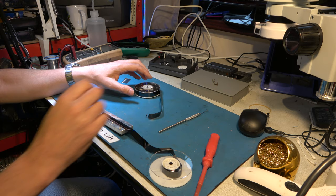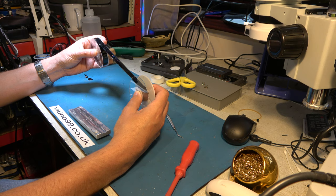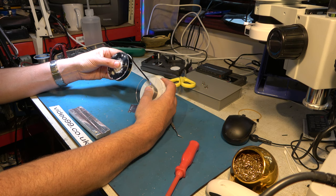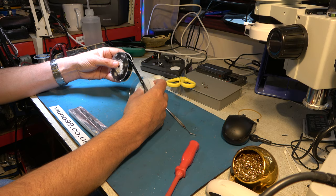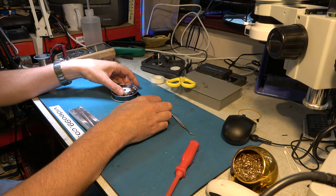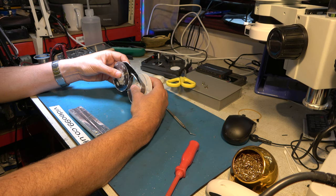This mold could be hazardous, so it's a good idea to be wearing a face mask whilst doing this. We have the tape prepared, but if I was to load that, put it back in the shell and play it, it would snap again. So we need to try to clear the mold off before it goes anywhere near a machine. One thing we can do sometimes is just apply a little bit of tension and occasionally, if you're super lucky, the tape will slip round and pull away the mold. It doesn't always work — you can cause it to snap internally, which means you get a join on the tape which will break later when you try to play it. So you really don't want to do this too much, and it's not doing it this time. This tape is too moldy for that trick.